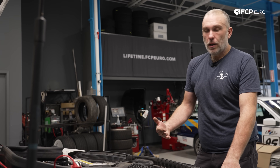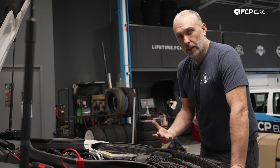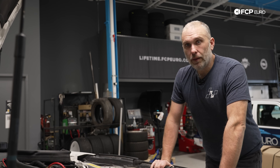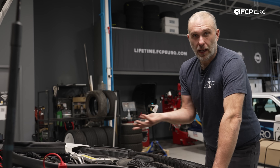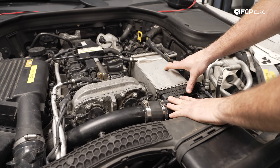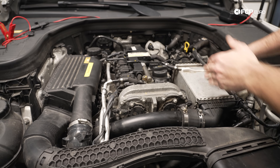So now we're under the hood of this Mercedes GLC 300, which has the M274 engine. The engine configuration is going to be different from car to car, but there are a couple of universals. If your vehicle has a split cooling circuit — low temp and high temp — it's going to have two expansion tanks. One is larger than the other. Your low temp circuit is always going to have the smaller expansion tank. You can also trace the expansion tank lines back to the intake manifold or charge cooler, which is always going to be on the intake side. That's your low temp circuit expansion tank.